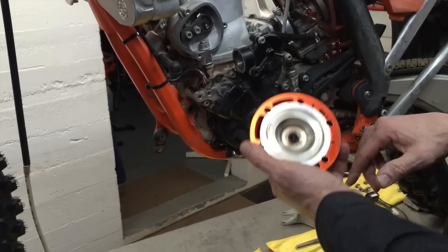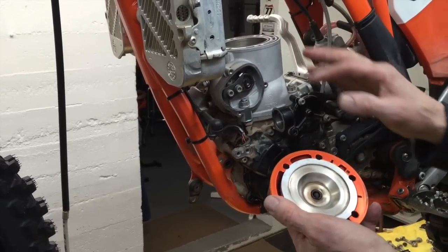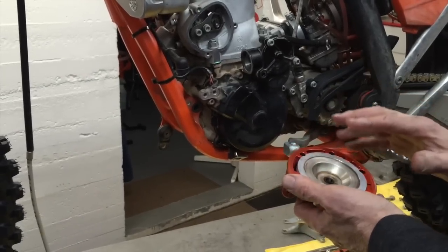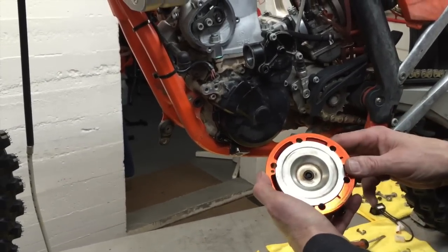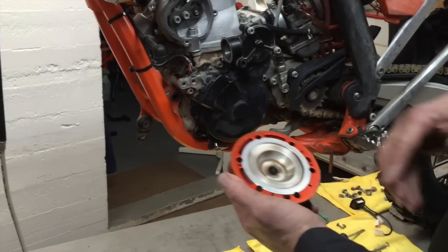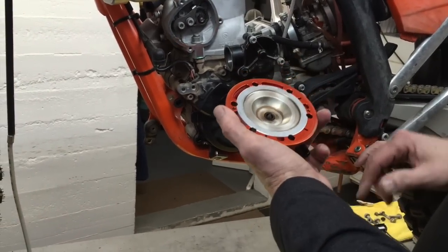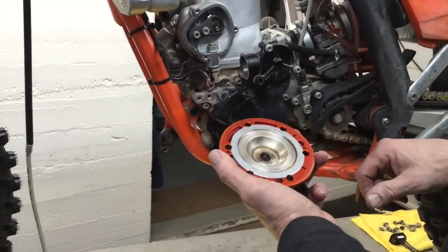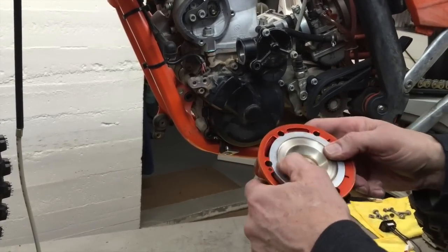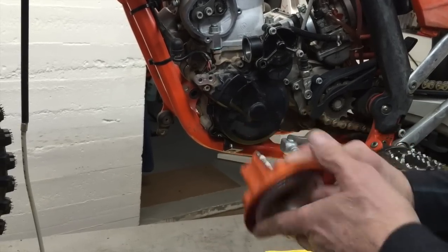Okay, so now it's time to install the head. We've got the O-ring sitting in there. Like I said before, you can use grease to hold them in. And the heads have always got carbon on them. It's totally normal, and I don't get real carried away. As you can see here, I don't buff it out and make it all shiny and look like new again, because it really doesn't matter. It's a total waste of my time and energy, because as soon as the motor starts, it's going to get a layer of carbon right back on it. So within a couple miles down the trail, the thing's going to have carbon on it. If you want to waste your time polishing it to the max, go right ahead, but I don't do that.